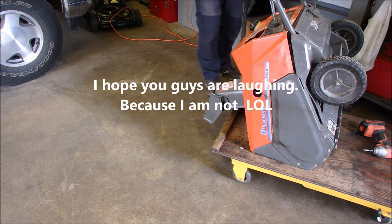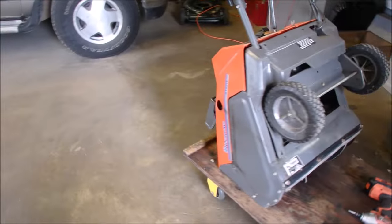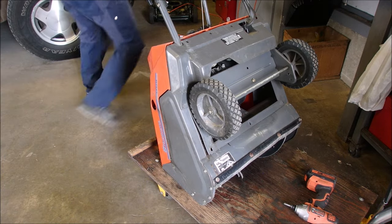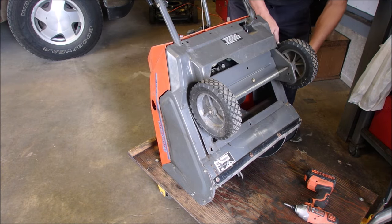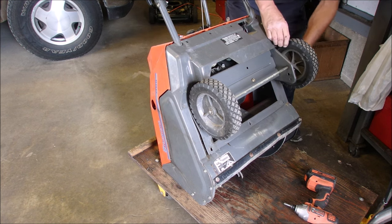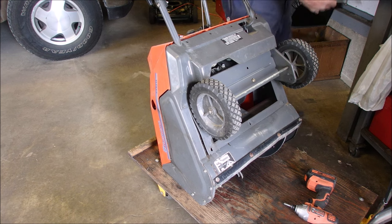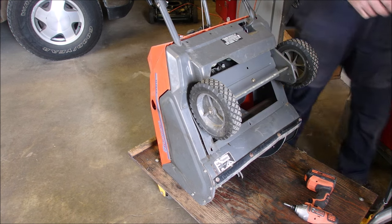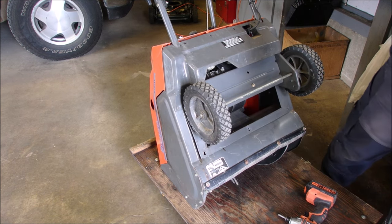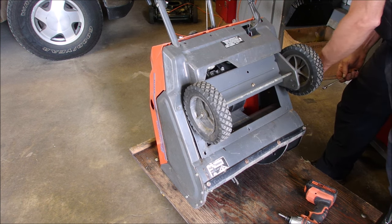Okay, let's get another tool. Looks like a 7/16 to me. So you can come and look over this side now. I'm working at getting this cover off. I got one more to go. It's a 7/16, it's a 3/8, by golly. No, it's not either. It's not a 3/8. Oh, it must be a metric. You gotta be kidding me. So 10, 11. It's a 10.